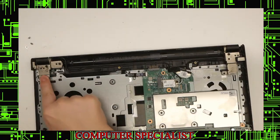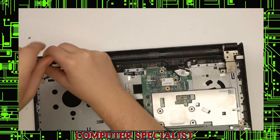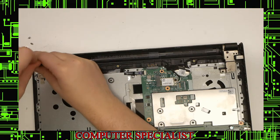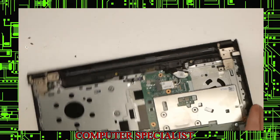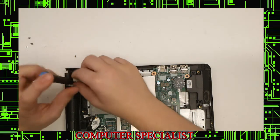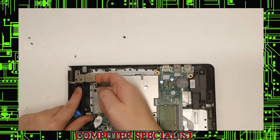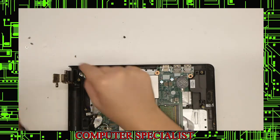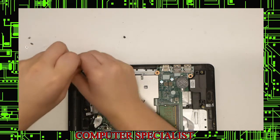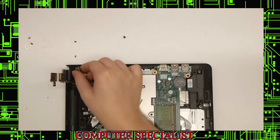Now we can see the hinges here. We'll make sure these screws are tightened down — they were both very loose actually. We can see the post for one of them is broken, but there are two that are still in. This is the side with the jack on it, so we're going to take out all the hinge screws here — in this case it looks like we only have one. We'll pull this hinge up and there's the jack underneath. It is typical that this plastic breaks off where the screw is, but in this case it managed to stay on.